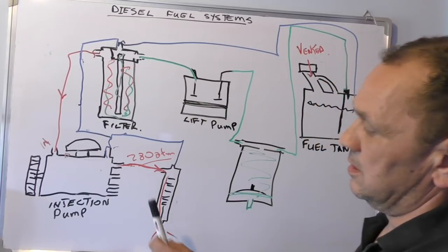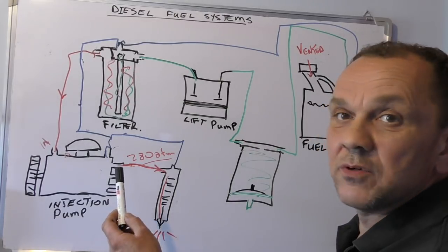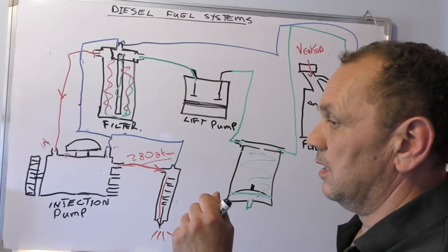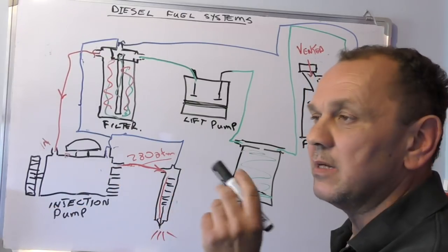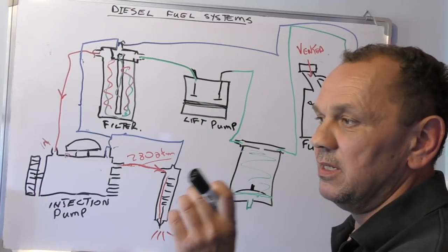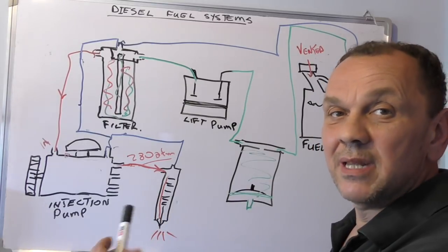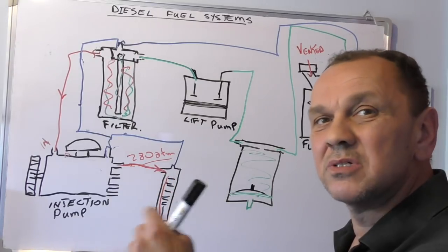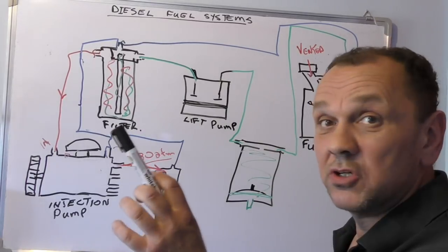With our injector — on the 200 and 300 TDIs they've got two pressures. One's a lower pressure which is a pre-combustion, and then you have your main pressure which is your main squirt. The second squirt gives you your power. The pre is the one that gives you a little bit of burn to start the combustion process. When you get onto later diesels you'll find that they squirt about five times — pre and post — to try and clean up as much of the exhaust gas as possible, and you get more power if you can control that.